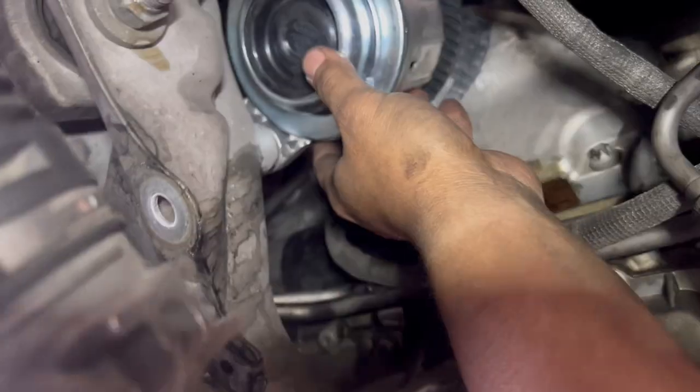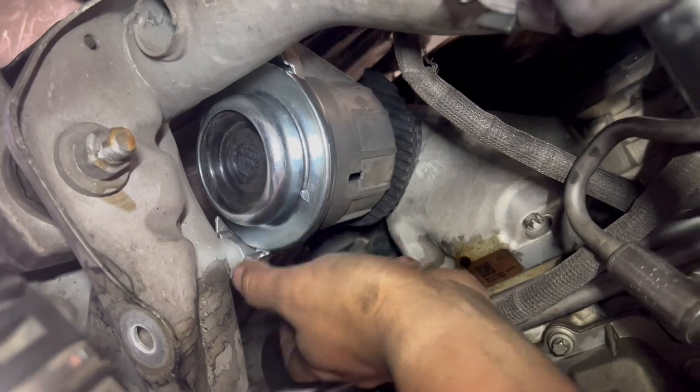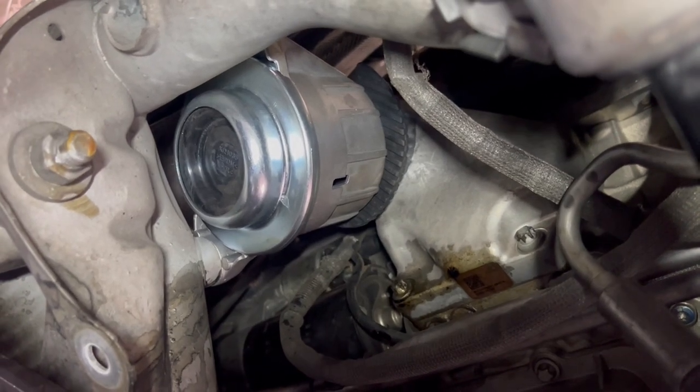Now I'm able to fit this in and it's in the right spot. What I'm going to do now is get that 16-millimeter bolt up top lined up, along with the heat shield — the heat shield goes first, then the 16-millimeter bolt while it's still supported, so you can wiggle it around if you need to line it up.